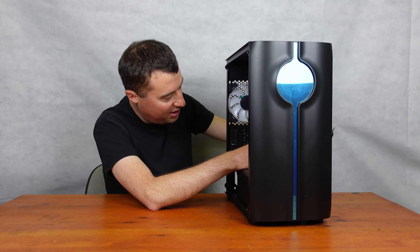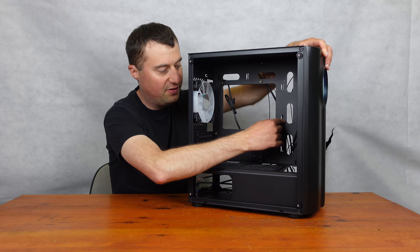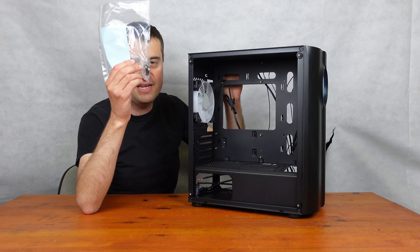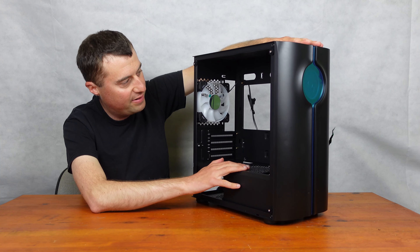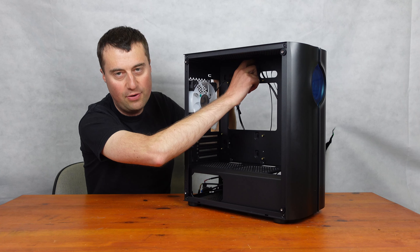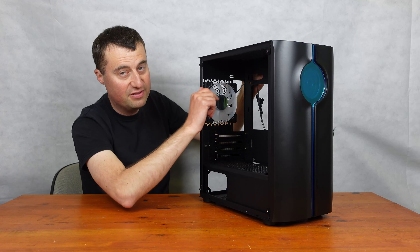We do have some pre-applied standoffs here. This is for six standoffs in the sort of typical micro ATX, fairly small-sized motherboard layout. If you do have a bigger motherboard, there are additional standoffs for that — I can see there are two additional standoffs in the bag as well. If you do have a bigger motherboard, you can obviously put it in there. As I said at the start of the video, this is only an M80X — it's only a micro ATX — so if you have a full ATX motherboard, it ain't gonna fit. And as I said previously, there is actually a lot of clearance at the top, so if you are thinking of going radiators with this case, you could actually do it and put a top radiator, because there is a fair amount of clearance there.